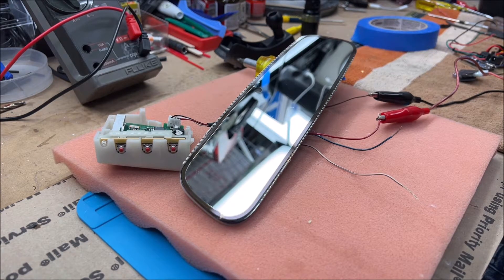For people wanting to upgrade their mirrors in older BMWs — let's say a mid-2000s BMW — personally, don't get one of these newer LIN bus mirrors. You can get it to work but it isn't worth the hassle. A 2008 mirror is going to look the same, the brackets are the same, it'll have HomeLink, the blinking LED, a wire for reverse lockout, possibly two auto dimming wires for your driver's door mirror, switched 12 volt, and ground. You'll have to figure out that wiring scheme, but you don't need a complicated solution to make the mirror work in your car.